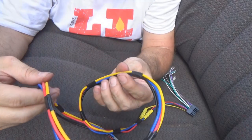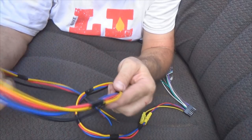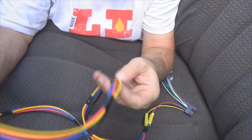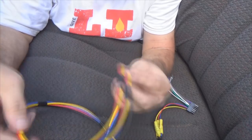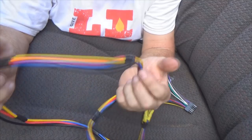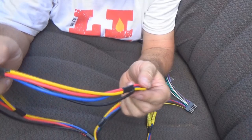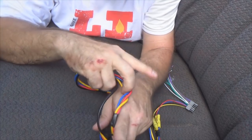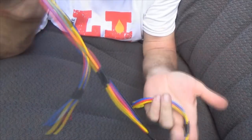I built wiring harnesses for a three-quarter ton Chevy crawler I used to have years ago. I had an old Mustang and a '68 coupe that I built the harness for. Whenever you group taillight wiring, fuel sending unit, whatever the case may be, whenever you group your wiring together, it's easier to trace it from front to rear, rear to front to diagnose issues. That's the reason I always like building my own harnesses when I can, for whatever rig I'm building. Because as much as I like building harnesses, ironically enough, I hate chasing electrical gremlins when things start going nuts. So that's where factory harnesses just drive me insane, because there's so many different ground ties, splits this way, splits that way. Factory harnesses are just way too overcomplicated. So there you go, let's put this thing in.